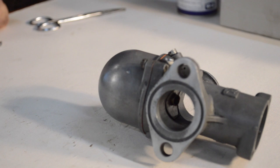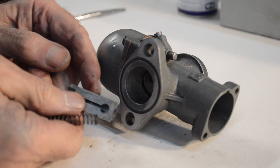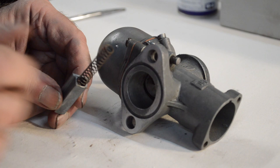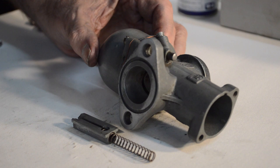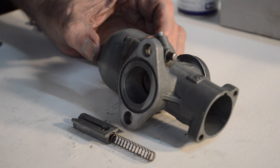That leaves us with our top end. The cables are not ready yet. The choke slide - I have discovered looking at the parts book - is missing a metal sleeve which should sit in there, and I haven't got it. So I'm afraid I'm going to have to go and order that now, which is typical of these sorts of builds when things come in boxes. There's not much point continuing this until we have that. So that can go back in the box, our bits can go back in the bag, and when our sleeve arrives we can finish up the build.